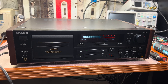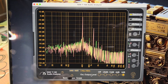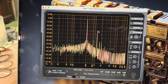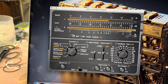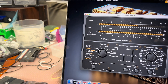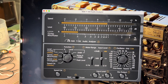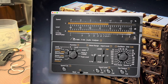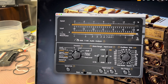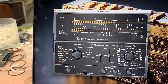Here I'm recording 400Hz at zero levels and THD on Type 2 tape is above the roof. The third harmonic is at minus 30 decibels. The source measures 0.25 to 0.2 percent, but on the tape it's above 4 percent. On the right channel, the source is 0.16 percent - I can clearly see the problem.